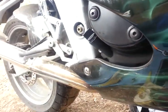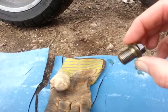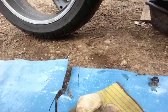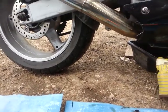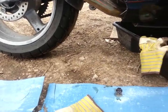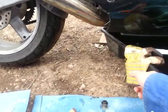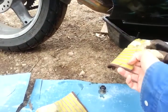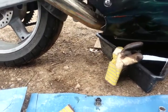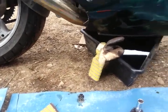Inspect your drain plug — these are usually magnetic on the bottom. Check the threads. It's a good idea to buy a spare plug even if you don't need it. Be careful putting it in and taking it out — don't over-tighten it. With aluminum cases you strip those out, you're going to hate yourself forever — the bike will sit waiting to get helicoiled and will probably leak constantly. Go easy on it. I didn't drop it in the oil vat either, so that's good. Got the glove full of oil — that's what gloves are for. I'll straighten the bike up and see if any more comes out, then show you when I'm done.